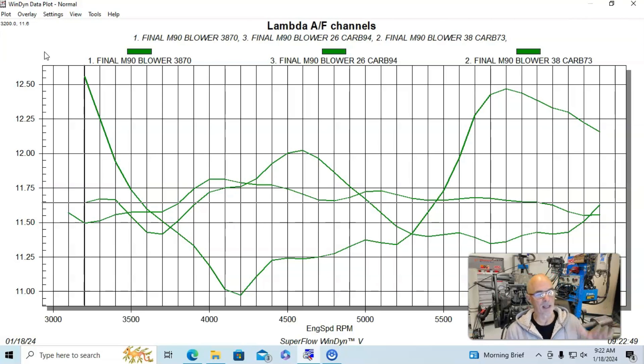It was nice on the roll-in — in the 11.7 to 11.5 range, nice and safe all the way through. That's what can be done with fuel injection. But in order to do that, one of the limitations is: if the air/fuel with the carburetor is too rich, we can't do anything with the fuel injection, because all you can do is add fuel — you can't take fuel away. You can't get a number less than zero. The only way to make it work is to lean everything out with the carburetor and then add with the fuel injection to dial in a nice smooth curve. But that obviously isn't ideal, because there's no reason to spend money on both a carburetor and fuel injection when you could just have one or the other.